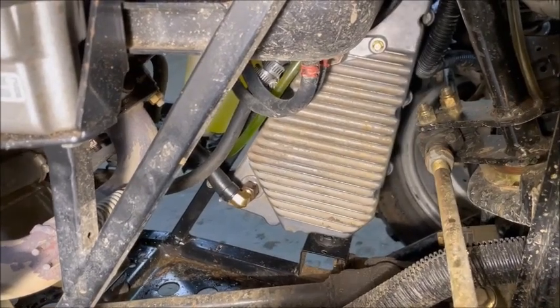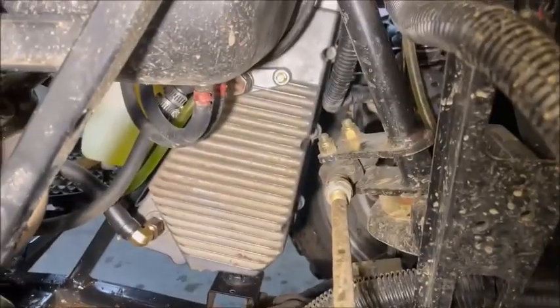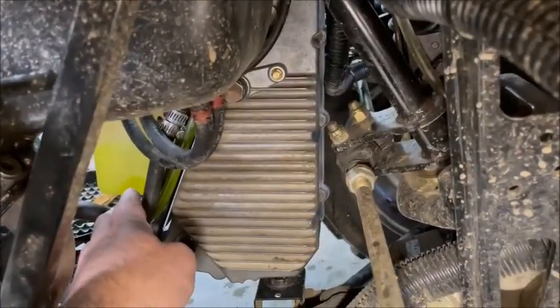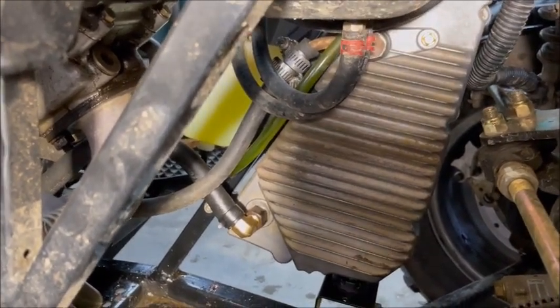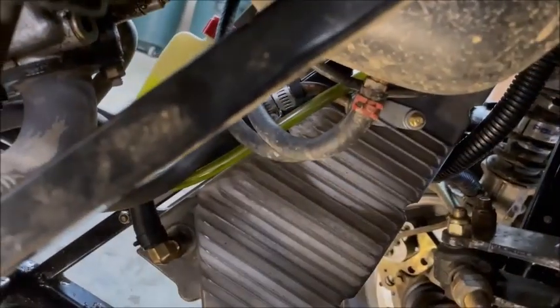I'll show you how all the hoses were routed on the other side. The big hose on the bottom — I left it the length it was and just curved it gently up into the fitting. The return oil smaller hose — I did have to cut about a half inch to an inch on the back end, but it routes nicely up and meets gently with the fitting. Two hose clamps to make sure there are no leaks, since that one is not a barbed fitting. The plugs are holding up and the top fitting is fine. No leaks — I just ran it for about half an hour and it looks good.